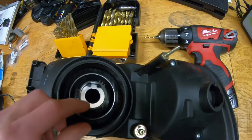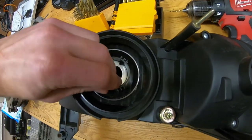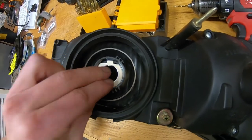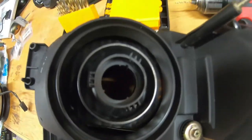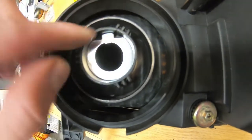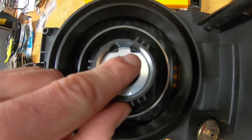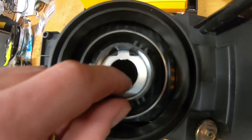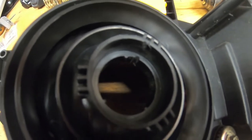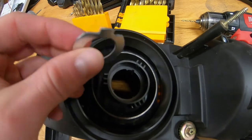So something I wanted to show you: you have this little washer plate that fits down in here and gives that nut on the back of the projector bowl something to grab onto. What I did here is take a very small 3/32nd bit. As this sits in there, the little notches are vertical - I just added a little hole, and that's going to be for our solenoid wires - the positive and negative that allow us to use high beam. I kind of used my bit as an end mill and got some of that material off, and that'll allow us to pass the wire through without chafing it. Now we're actually going to have to trim the shroud of the projector.